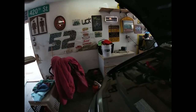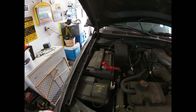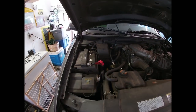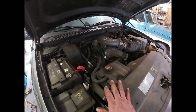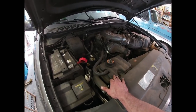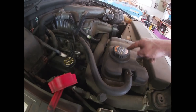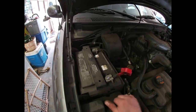For now we're going to get a new battery in here and get it fired up for you guys. Got a fresh Interstate battery in here and I've checked all the fluids. One thing to remember if you're working on a Lightning and checking fluids — these engines are intercooled, with a water-to-air intercooler mounted underneath the supercharger. They do have a separate coolant reservoir specifically for the intercooler, so just one more thing to check. All the fluids are good.